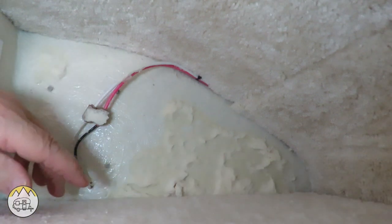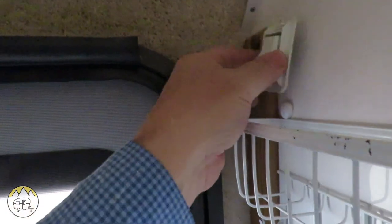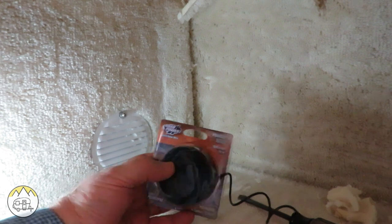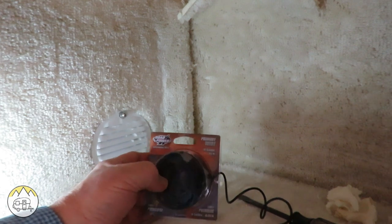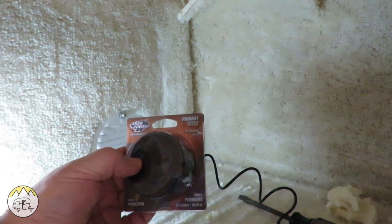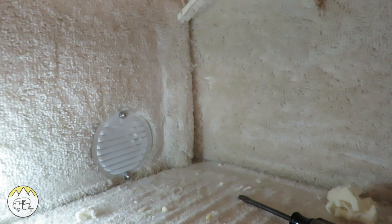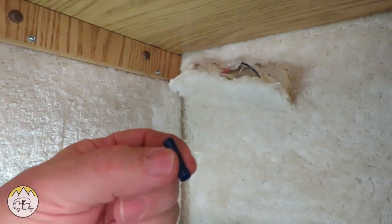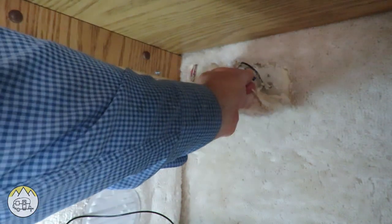My wire is going to come up through here. Here's the back side of the switch where I'm going to hook the wires in. The wire used in the trailer that goes out to the light fixtures — that black wire — is 18 gauge wire, so I have some 18 gauge primary wire here. You can get it at auto parts stores or hardware stores. I'm going to cut it and use a plain splicer to splice it.